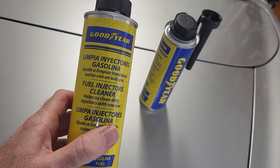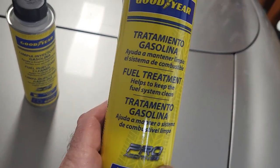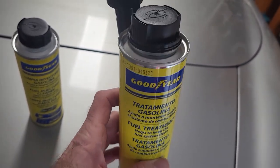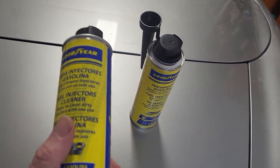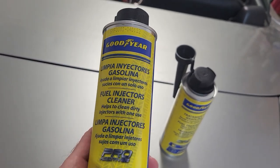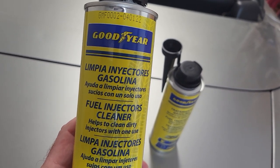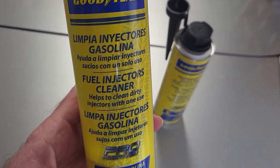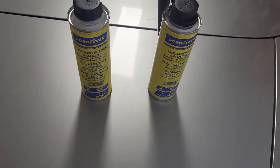Here's what I've bought — a pre-inspection kit. Two bottles came in the kit: one is a fuel injector cleaner and the other is a fuel treatment that helps keep the fuel system clean. The packet says to put both bottles in, but I wasn't sure about that, so I'm just going to put the injector cleaner in first. I've got about a quarter of a tank, so I'll put this in, fill the tank up to the top, and then do quite a bit of driving to run it through the system before the inspection.